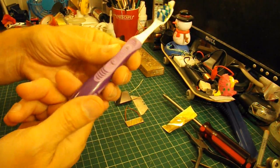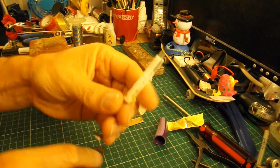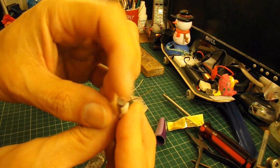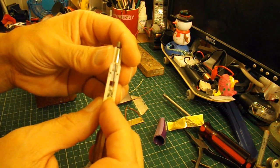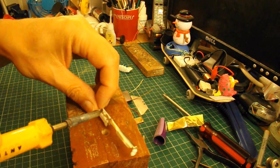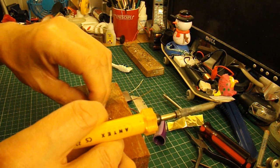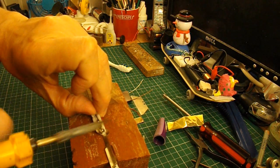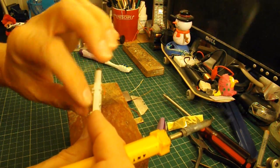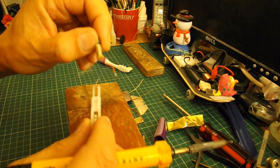So we'll take the motor out of here. That's the motor, and at the moment because it's a vibrating toothbrush it's got this little vibrating weight on the end of it. So I'll desolder it. That's one wire, that's the other one. Don't try and just pull them off — you can cut them but don't try and pull them because they'll pull out of the motor instead of off the solder.